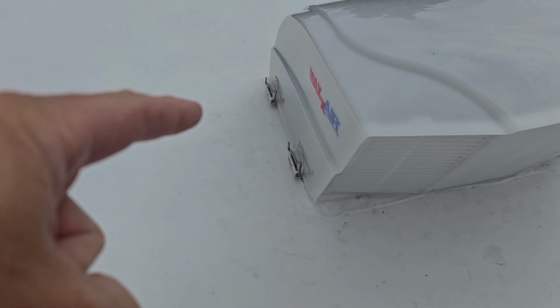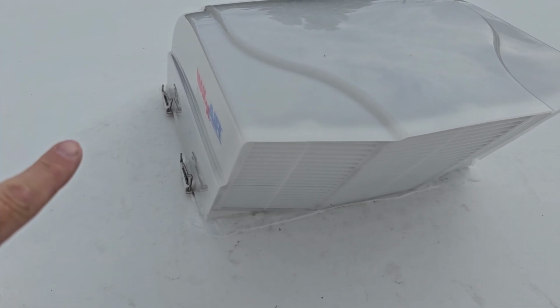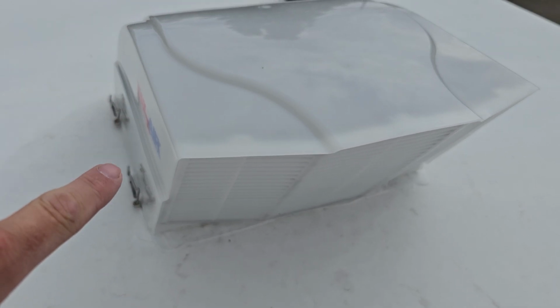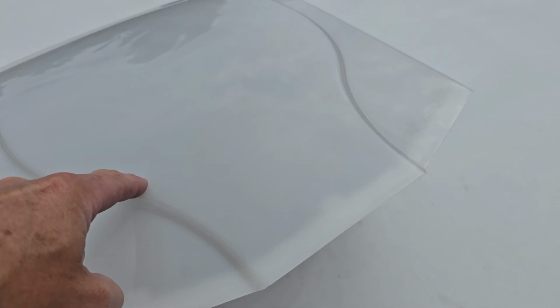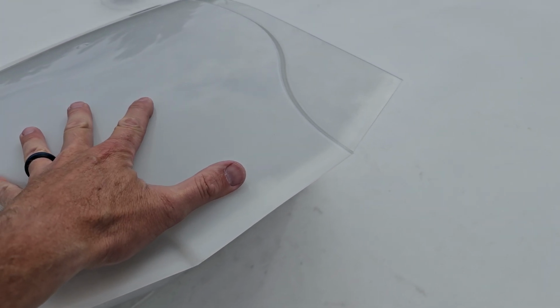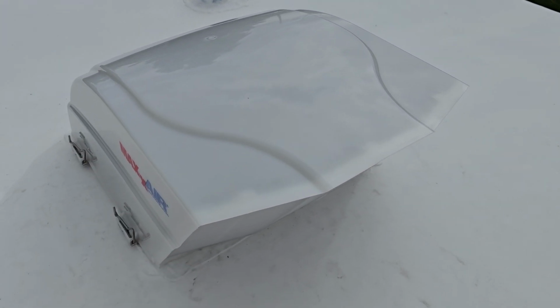Right, so up on my roof, guys, we install these on all of our campers. They keep weather out. They keep the ability to have your vent open even in the rain. And what this also does is add an extra layer of protection, meaning if you get hail, this is way more robust than just this. So if you park yours outside and you don't know if you've got weather or not, even if this cracks, it usually will not let it puncture all the way down to this one. So if you have this one closed, then it's going to add that layer of protection.